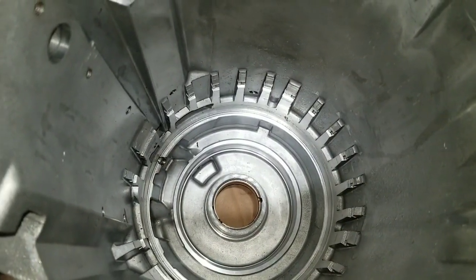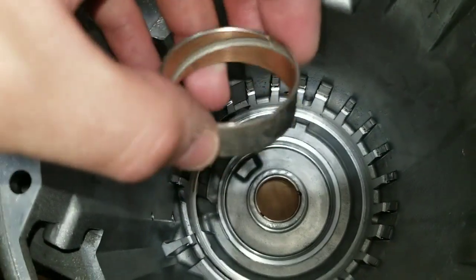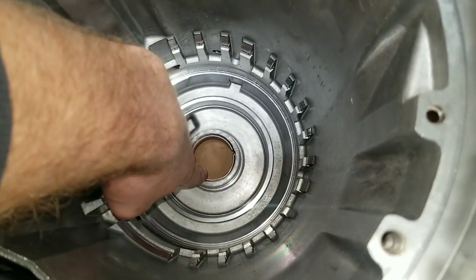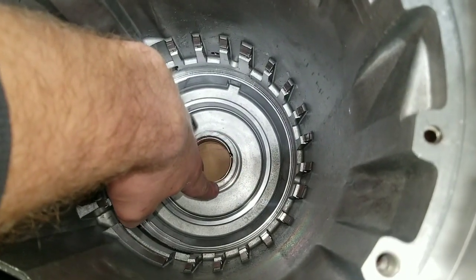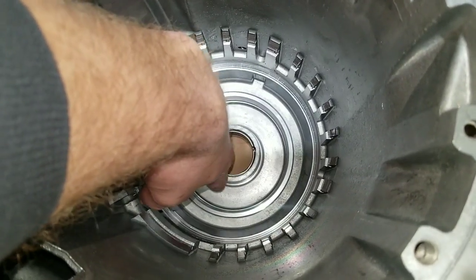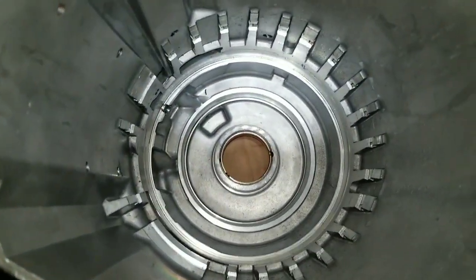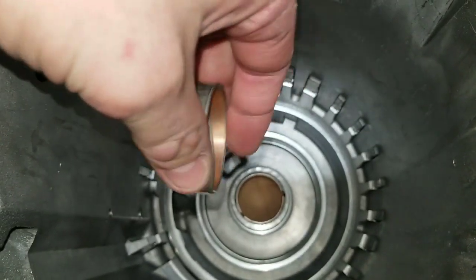All right, I'm recording this on my phone, so I had to make a quick correction. I'm uploading it from my phone, but I just rewatched the video, and I said that the bushing should be approximately a half inch below this surface where the Torrington bearing on the back of that hub that attaches to the ring gear rides. It should be about 1/8 of an inch, and that was per the Cliff McCormick ATRA guide, the book.